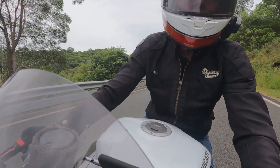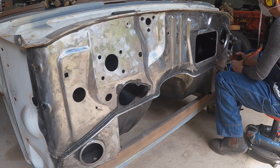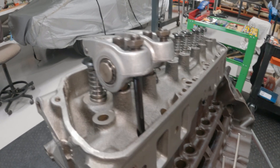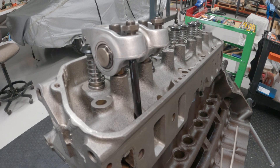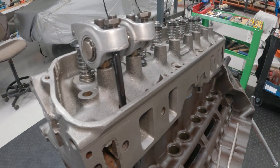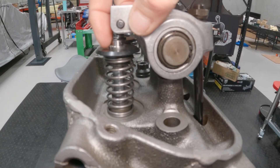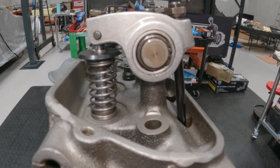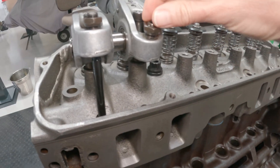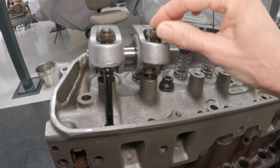But I've found a solution. There were three goals I wanted to get to with this valve train. First goal was to solve that zero lash problem on some of the valves. Second goal was to have really good movement of the roller tip of the rocker on the end of the valve stem. And the third goal was to use about half of the rocker's adjuster range, so I'd have range left in either direction for future adjustments.